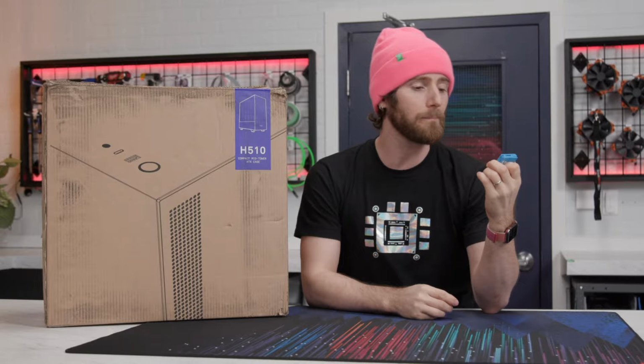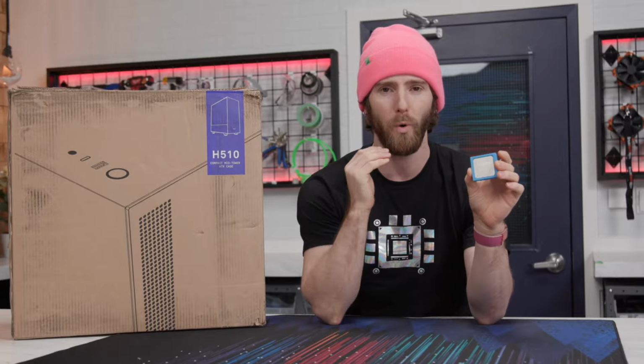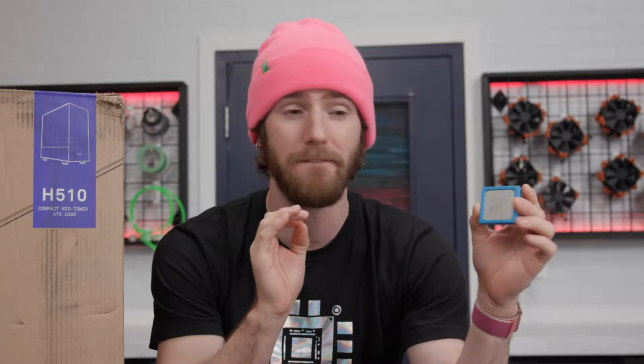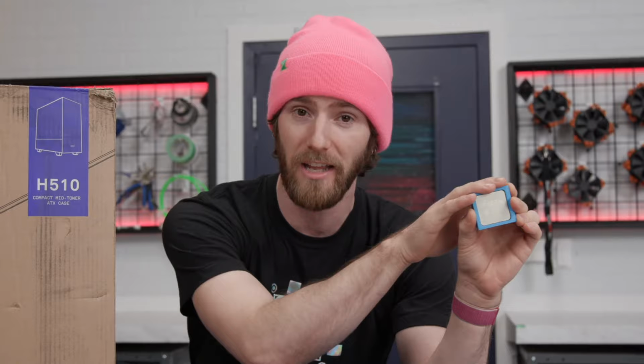We're gonna be starting with a Ryzen 3 3100. This is basically the way to go, assuming you can actually find one in stock, for a value for the dollar brand new gaming rig today. It uses AMD's Zen 2 architecture, so that means that it's quite a bit faster than their first attempt at Ryzen, and it's got 4 processing cores, meaning that basically any gaming application is gonna have all that it really needs, and that's gonna be true probably for at least the next few years.